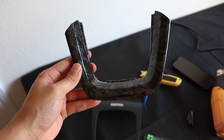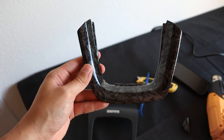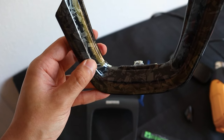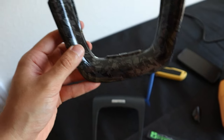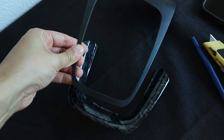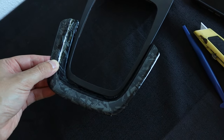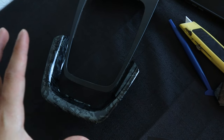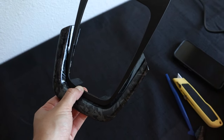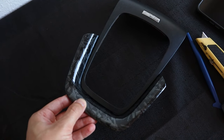Here is what the piece looks like now. This piece is more complex because of the curves, and this is where you see a benefit of removing the piece entirely — there is a little tear in the corner. I'm going to put some vinyl over it to keep it from stretching more, but whenever this trim piece is installed another piece actually goes above it and covers that section, so it has clearance before you'd even see it. If you hadn't removed the piece you'd have to redo it entirely; with removal it's an easy fix and you won't even be able to tell.